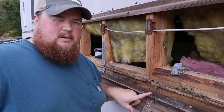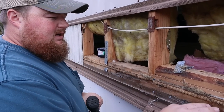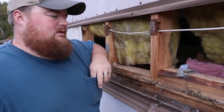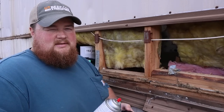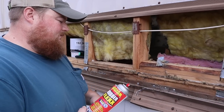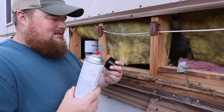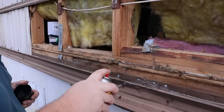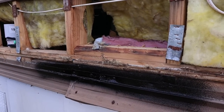Angela had the idea of using some panhead Phillips screws from other trim pieces to attach this much better and flatter — good job, Angela. I'm getting ready to flash tape over this to make it totally sealed up, and then use rubber head roofing screws to fill in all the holes. Angela's talked me into trying the rubber flex spray on here instead. There's only like one little pinhole, so this should work pretty good. The only bummer is we got the black, but having floor leaks is more of a bummer than black on brown.